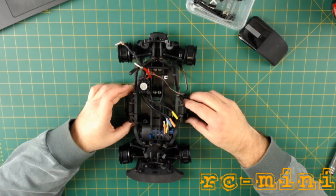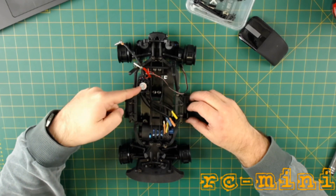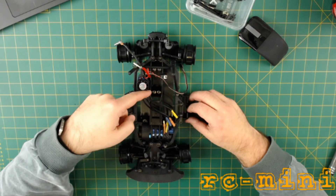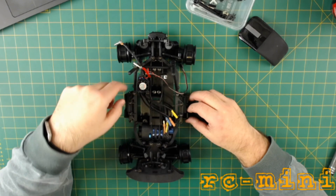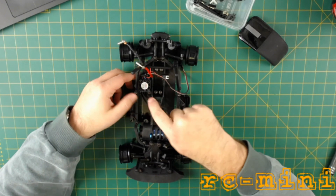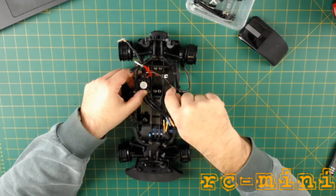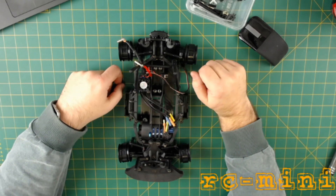The trick here is because of where the pass-through holes are under the chassis to get the wires from the speed controller across to the receiver on the other side — if that's how you choose to do it — there are some little access holes underneath the servo so you can hide the wires. The only snag is the access holes are where you'd want to tape the ESC to the chassis. So you're going to have to put the wire across and let it sit out a little bit so there's room for the wire to bend through and go under. Just a minor design issue, nothing of significance.